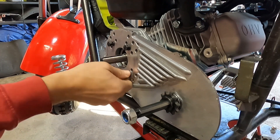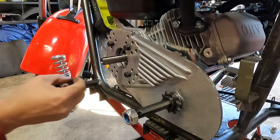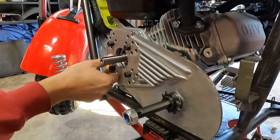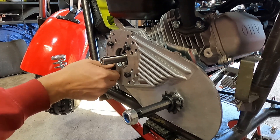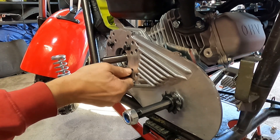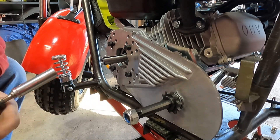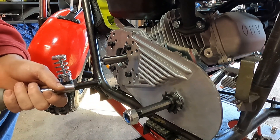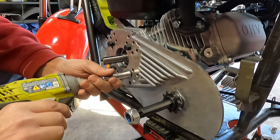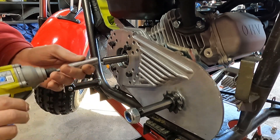I use the Bullet Lines torque converters and I've always had really good luck with those — they seem to be really good torque converters. The built engine I had on here was a modified 212 with a billet rod, PVL flywheel, 22-pound valve springs, hot 265 cam, advanced timing of 32 degrees — and I had the same belt on that thing for a year. If you put everything on there like it's supposed to be and line everything up correctly, you're good to go.